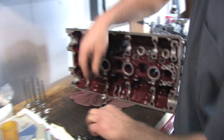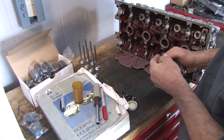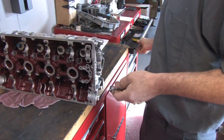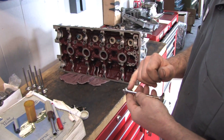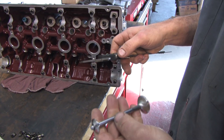So the method we're going to be using is the effective tip height minus our spring seat thickness and the distance from the bottom of our retainer to our tip. We're just going to do the math — some backwards engineering.